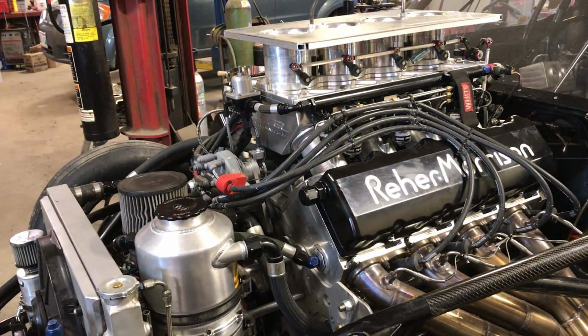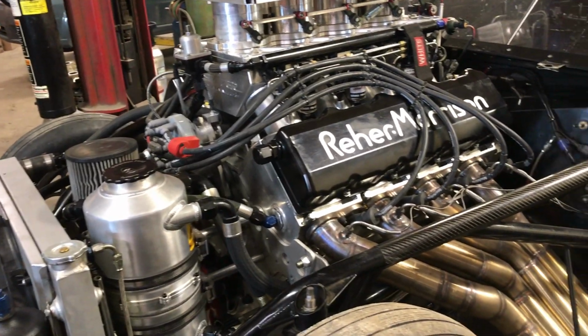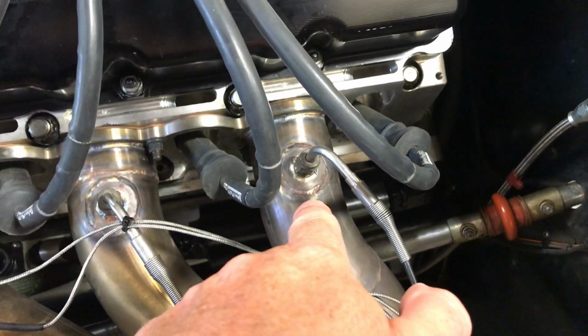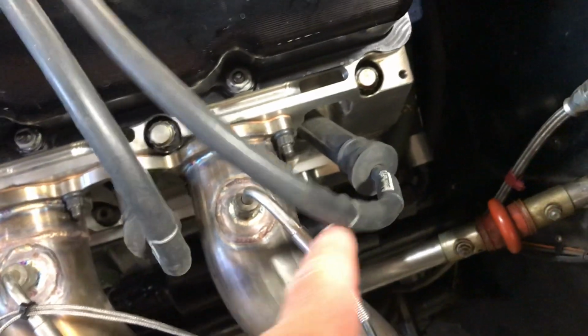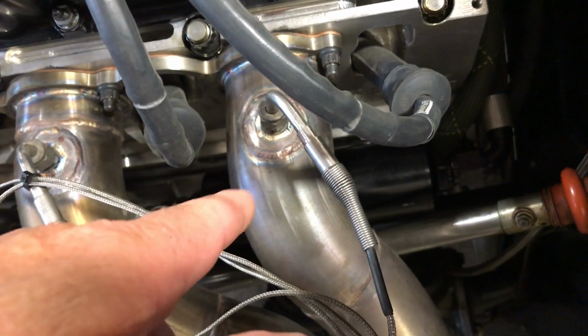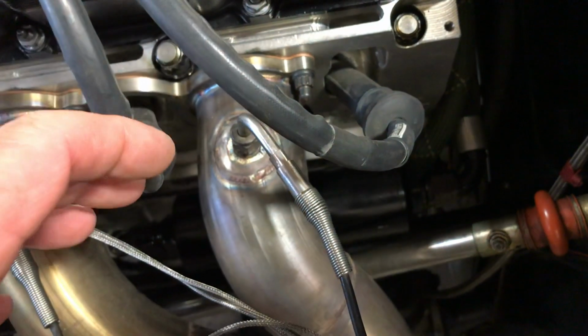So we'll try that. He's going out again this weekend. I can't go with him this weekend, but he'll keep me posted on how things are working. And then the oil filter is down there, and I took that all apart and cleaned it all out. And it turns out that these ends can go on either side, and on the filter it's got a flow arrow, so it flows that way, but the filter is supposed to only go in one way. And what happened was, I guess when the guy refreshing the motor took the motor apart and cleaned that all out, he had the filter in backwards. He had the flow going the right direction, but the filter was in backwards.